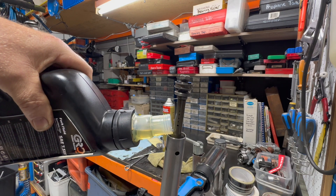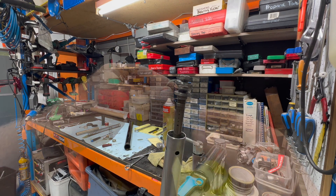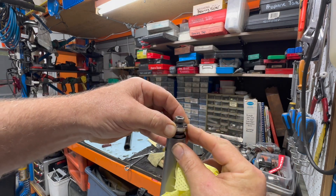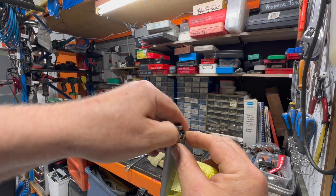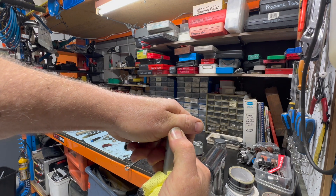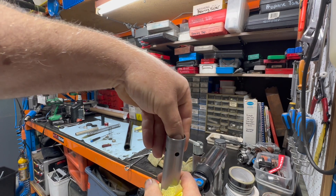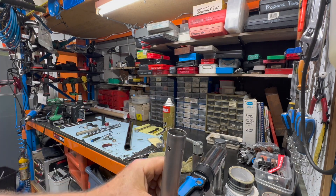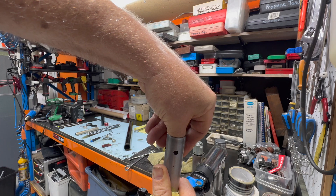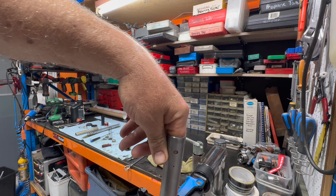Once you've got that back together, fill the oil all the way up — this is critical. We want to get this whole system in a bath of oil, not in air. Pour oil in until it just starts to come out those bleed holes at the top. Put your Teflon band back on, and gently bring this down into the cartridge — be really careful that the band goes in nicely and doesn't get hooked up. Ease this down, squeezing out any tiny bit of air through those side holes. Get the piston under the oil — just pushing down really gently with my thumb, allowing any air to escape. Then we want to put that bung back in and remove the screw to allow a bit more air out, getting everything in a bath of oil with no air bubbles at all.